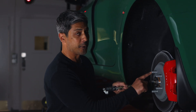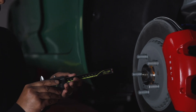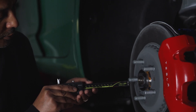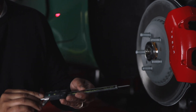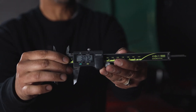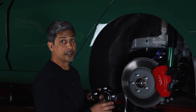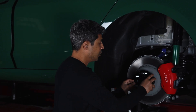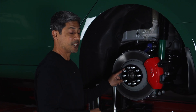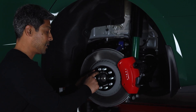Now that you know what we need to take into consideration, we're going to measure the length of this stud and compare that to the pocket. You've got almost 31 millimeters. The next thing you'll do is calculate the size of your spacer — this is a 15 millimeter spacer. So 31 minus 15 means there's about 16 millimeters of stud protruding past this spacer.